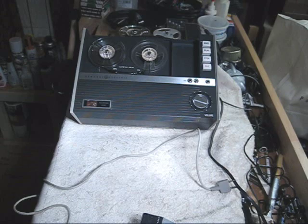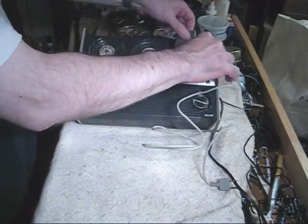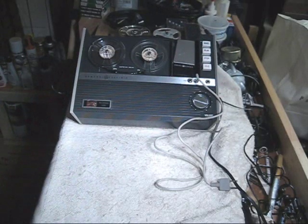The mechanical transport is very good. The microphone that comes with it sits in this little area right here when you wrap up the wire and everything. It is a crystal microphone, and you can hear it's not very good quality. So overall, I wouldn't say I was able to restore this machine — I was able to get it to function again. The problem it had was the belts were gone, they'd simply stretched. But the machine was fairly well-kept; I think that 40 years have just done it on the amplifier.